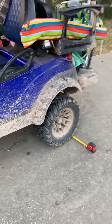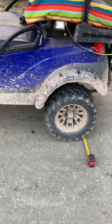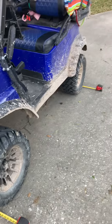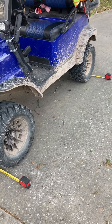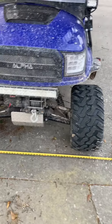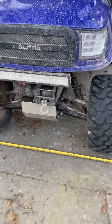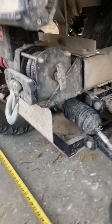The back rides like hell. It has the heavy-duty leaf springs and I'm on my third set because I keep bending them — which gives you a sense of how hard we drive the cart. I'm going to build a four-link for the rear so I can stop destroying it, but the front end is working great.